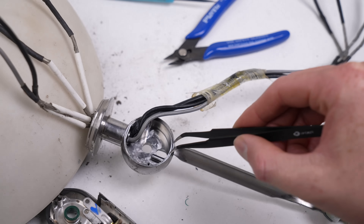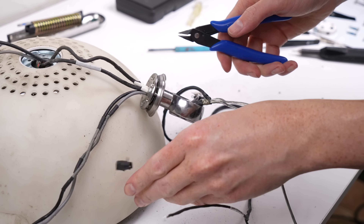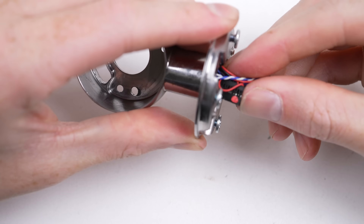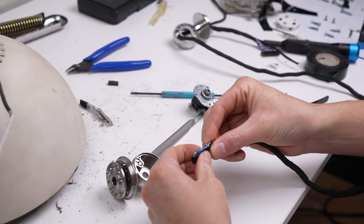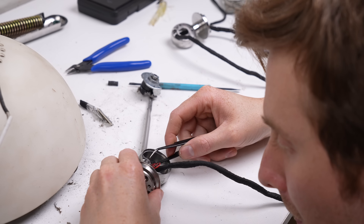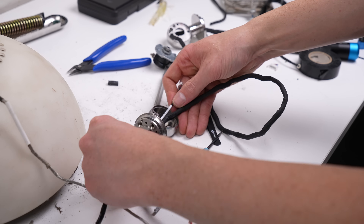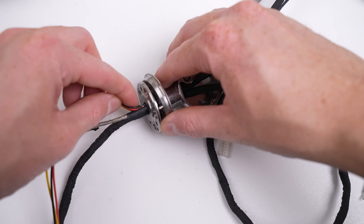Once I remove the bracket and inner piece, I found the missing screw from the other end and this weird piece of rod that I have no idea where it originally went. I'll be reusing the power LED and microphone cables, however the remaining will be discarded - I had to cut them out as the hole at the base was only about 9 millimeters and it was impossible to remove all the original cables intact. It was then the process of routing the new display cable through first. It was a tight fit at the top section, and the lower section was so small I genuinely thought the wires were going to snap. A few wires had sustained some damage to the insulation which I had to fix. I also had to remove the connector from the backlight cable in order to feed it through, reconnecting it once in place.